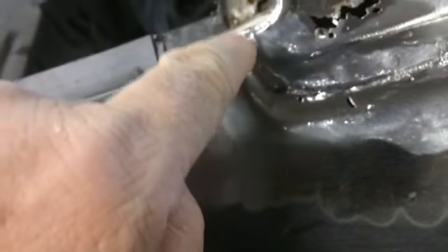We're going to get to digging and drilling and cut these out, or probably just take a little disc and grind them out. They've got a pretty good weld right here, but that's the piece that's got to come out to expose the top of the quarter. Tried not to get it too hot — I think we did okay. Pretty good bit of lead in that little seam there, but I've still got a little bit of pieces here and there to get out. Once we get this piece out, we'll start cleaning everything up and then do the same thing on the other side.